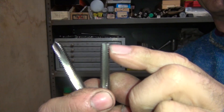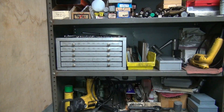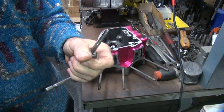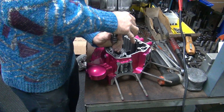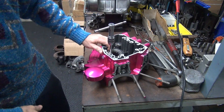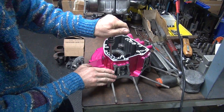This one is a tapered end, this one here is not quite so tapered. We don't want it to cut any threads into it, we just want it removed. Get a tap driver - it's known as a T-handle. What we're trying to do is get the bushing to come out. You go ahead and start threading this in and the bushing will start spinning in the case. You have to push in fairly hard to get it to start. A little bit off center actually helps jam it in better, but I still try to get them relatively close. Now you just keep turning until the bushing turns.